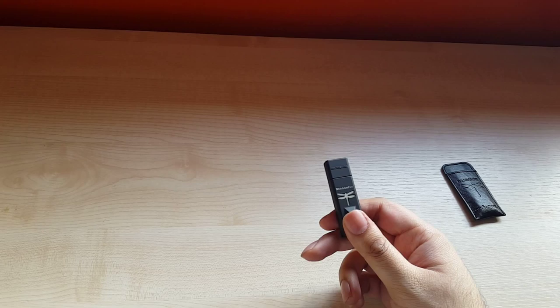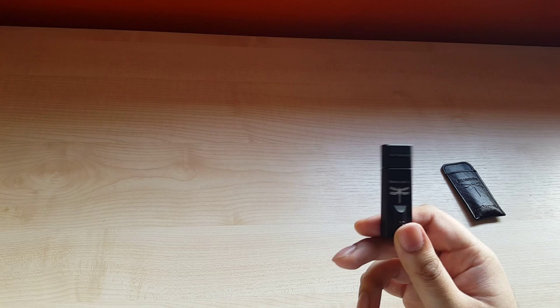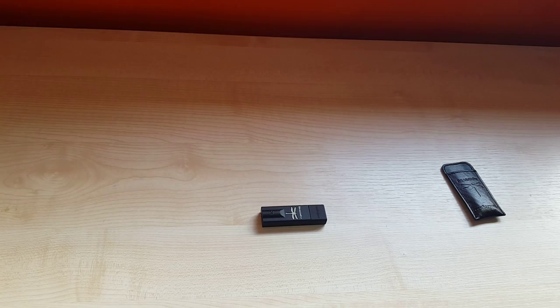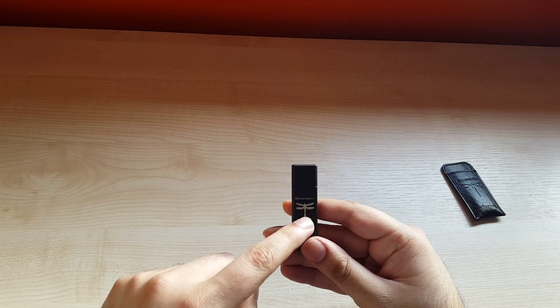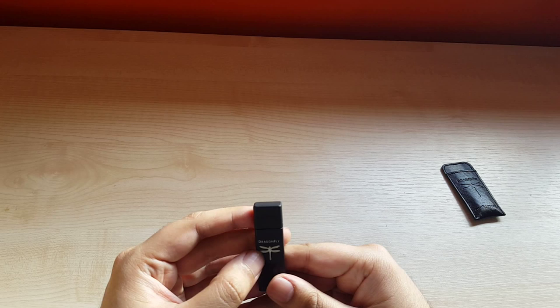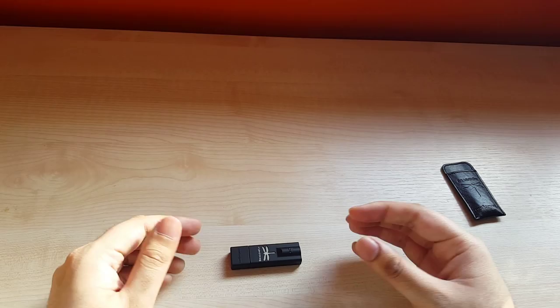If you want to play and downscale songs you'd have to use it as a primary driver, not WASAPI. WASAPI can only go up to 24/96 because it's bit-perfect — it just tells you what can or can't be played by your DAC. When this plays different sample rates — 44.1, 48, 96kHz — the dragonfly LED lights up in different colors. The highest, 96kHz, is magenta, while the regular rates are blue or green. If you run it through your primary sound driver it'll always be magenta; you need WASAPI drivers to see the color changes.